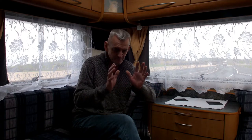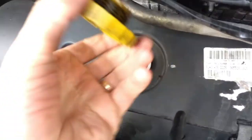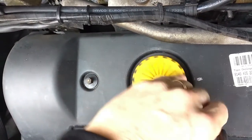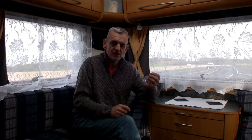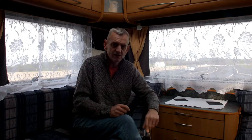So that's what you're looking for in the water. Next, take the lid off the oil cap and when you're looking at that lid, you're looking for gunk — white, frothy gunk — which means the oil hasn't been changed for a long time. It should be nice and clean really. Then take the dipstick out and have a look at the oil — see if it's nice and fresh and clean, which would show it's had an oil change.